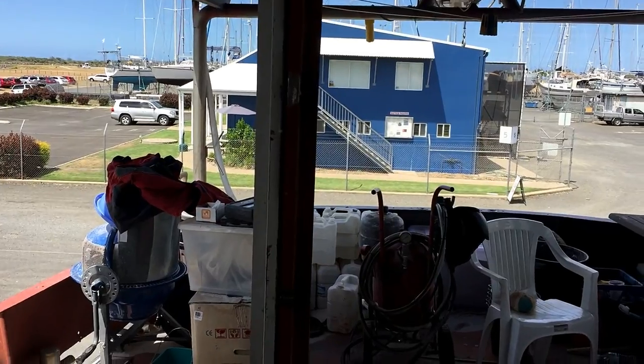So Malcolm and Rod came over and gave us a hand to straighten up the doors. So we had a few warps and bends and stuff like that from putting a bit too much heat in when we were welding. However, we managed to get the doors absolutely blimmin' perfect. So what we've done, come back over here. I'll flip the camera around and I'll show you.